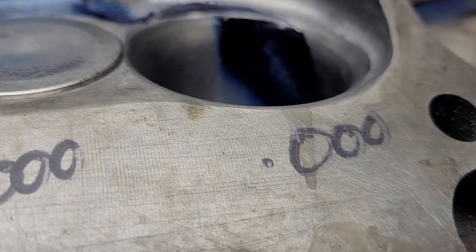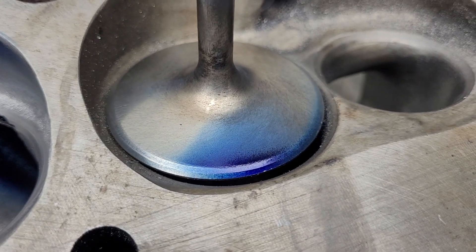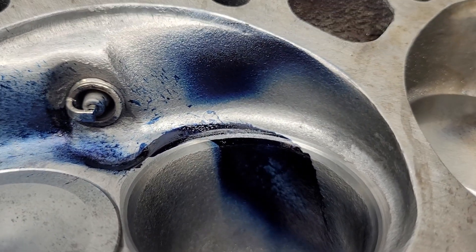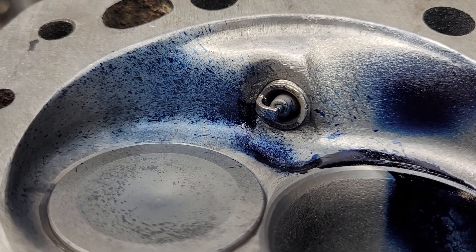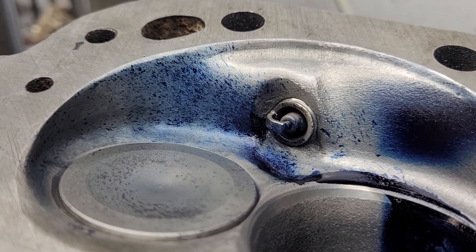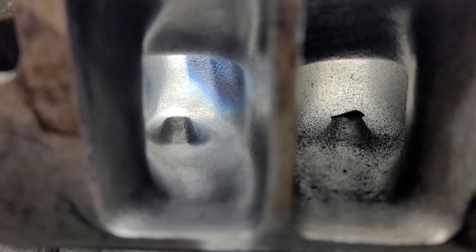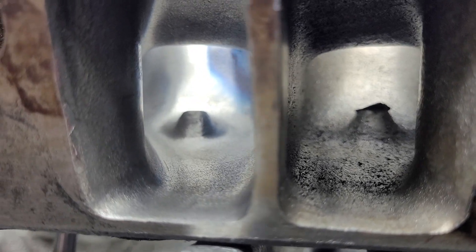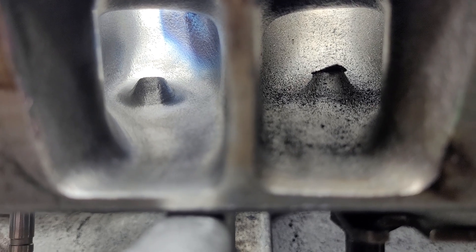What I did was work on evening out the speeds on that short side radius a little bit. The intake valve looks pretty decent — just look at that nice wide spot. It did go towards the roof a little bit more. The chamber cut looks good, we've got a lot of splatter — actually more than the usual amount of splatter across the plug, and it's all the way around that chamber. The port itself hasn't been changed; I did give more area in certain areas of the short side radius to even out those air speeds across the short side.